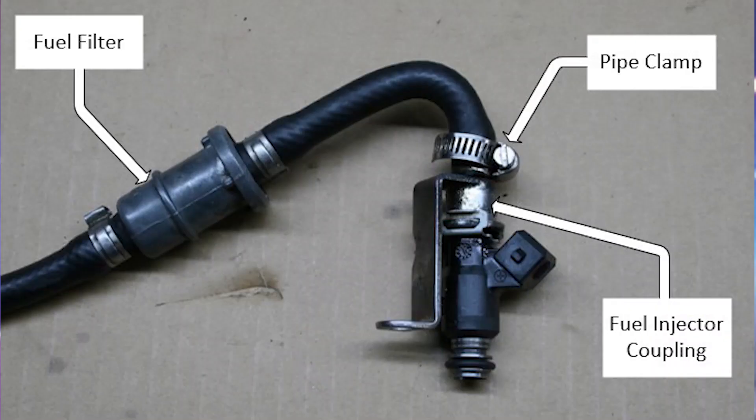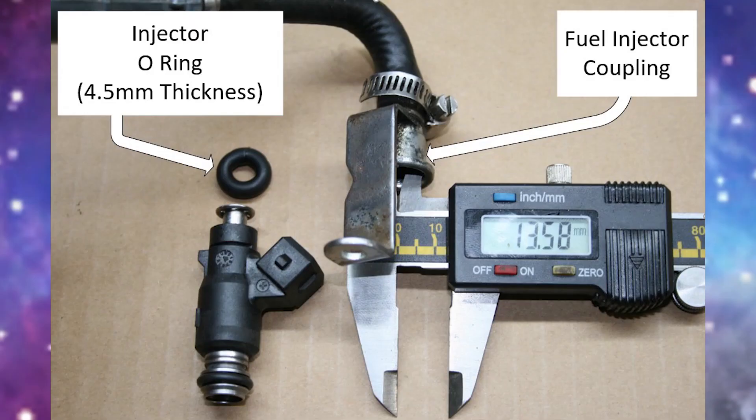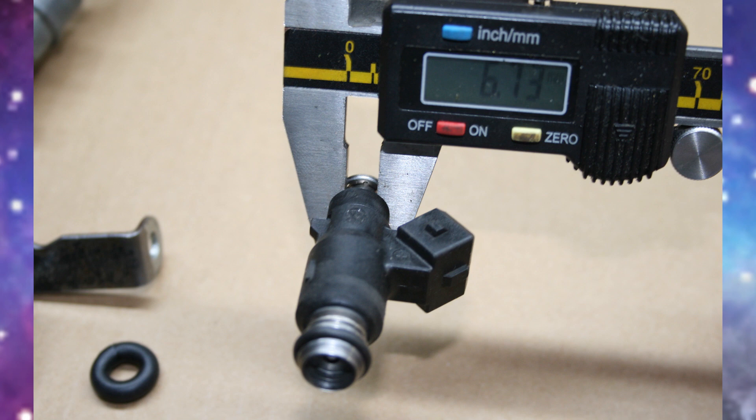You may be tempted to test the fuel injector. If you do, be sure to disconnect the injector at the pipe clamp and not at the coupling as shown — it's tightly held in the coupling by a non-standard O-ring not shown for sale on the LXR LexMoto sales site. In my case I had to make my own by purchasing a short length of 4.5 mm thickness O-ring cord, cutting it to length, and then splicing it together as an O-ring using super glue.